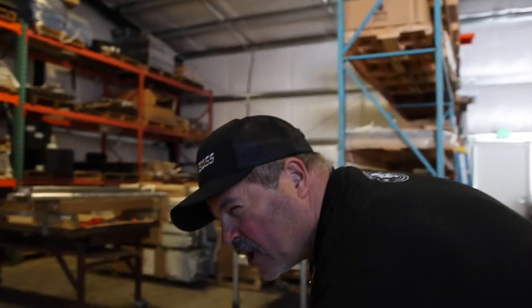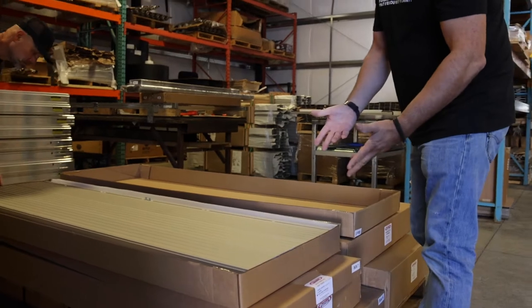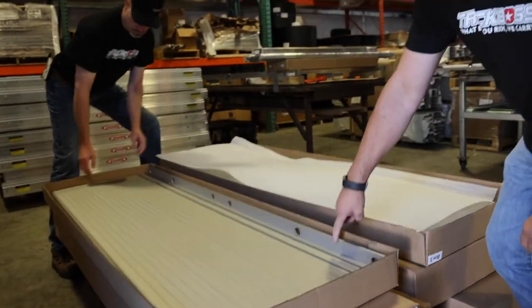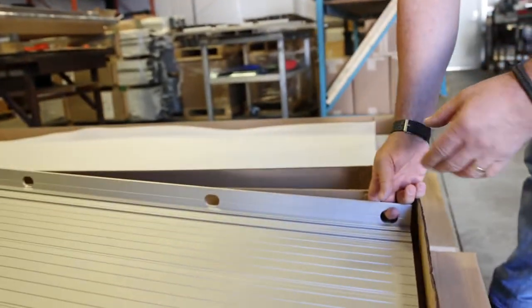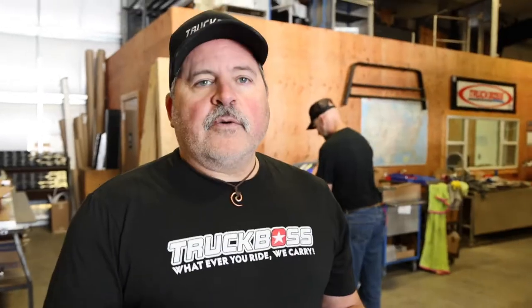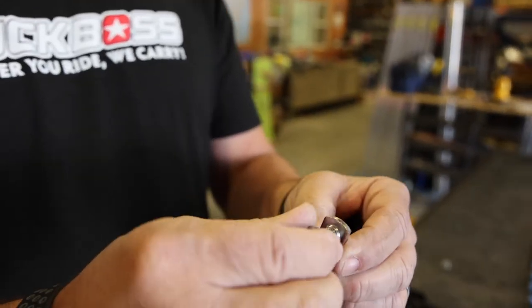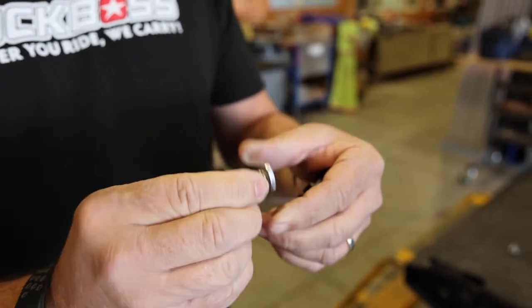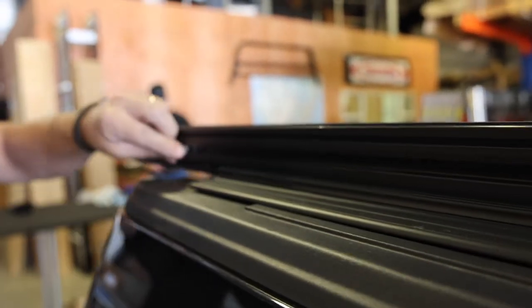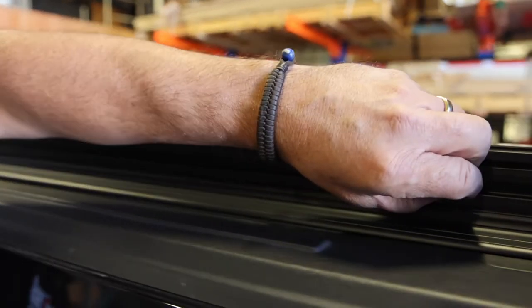Now that we have the rails on and the tail legs on, you're ready for panels. These are your panel boxes — box four and box five. Just open those up. You'll see the panels are all pre-constructed. Get the center panel out first — you'll notice it because it has a header on it with drilled-out holes. An important tip: we package the front bulkhead, which is the seal to the front of the deck, on the inside middle panel, so pull that out as we'll be using it shortly. Before we lay the panel on, take this little part and the stainless steel button head, put them together — this is going to hold the front bulkhead in. It just simply slides in; make sure the bolt is toward the front of the truck and slide it all the way down to the front of the pickup.